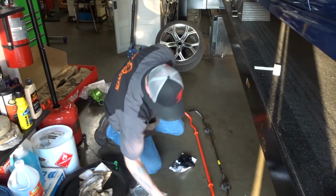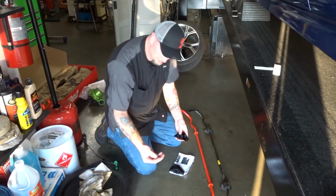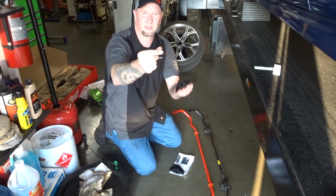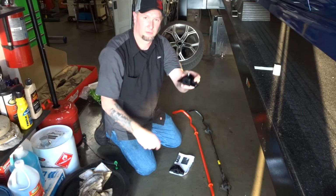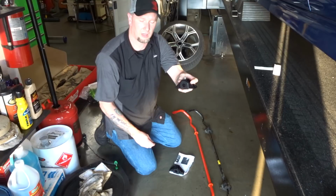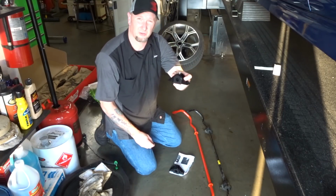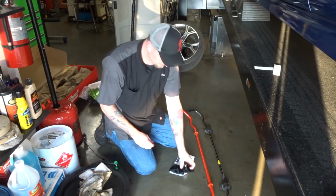Okay, got your lube for the bushings, got your bars, and there are little zerks, the tiny zerk fittings that screw into the top of the bar. Make sure you put those in so you can grease them for future use, so you don't end up with a squeaky sway bar. Make sure you put the zerk fittings in the sway bar bushing holders.